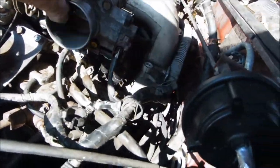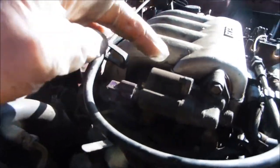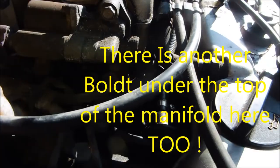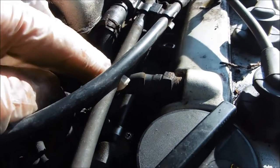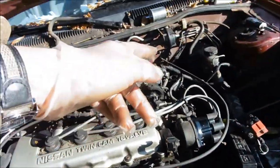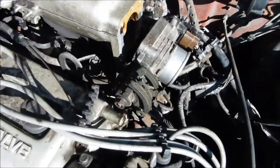You can see all the bolts are off but it's still not loose - I think there's one bolt still holding it. I got this air hose loose. There is one hose down here that I forgot. All these hoses here are loose, so next I just need to pull that bolt off. The injector should show continuity - mine didn't, so I ended up taking it off.